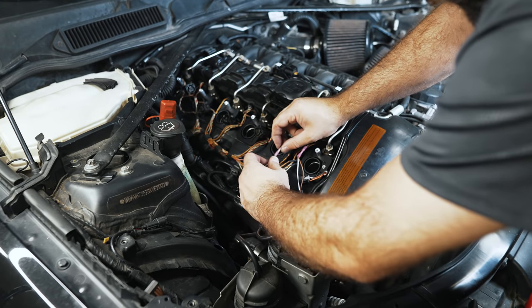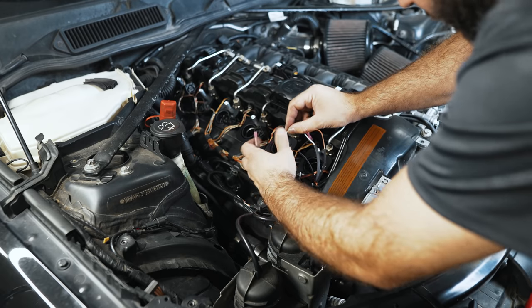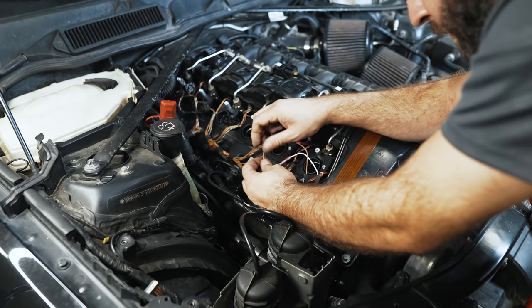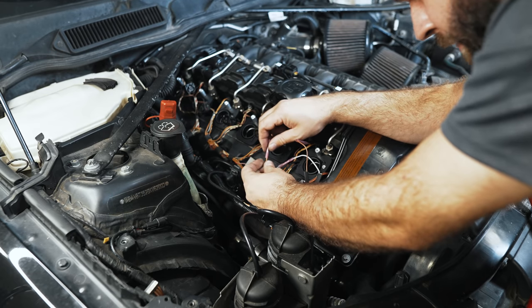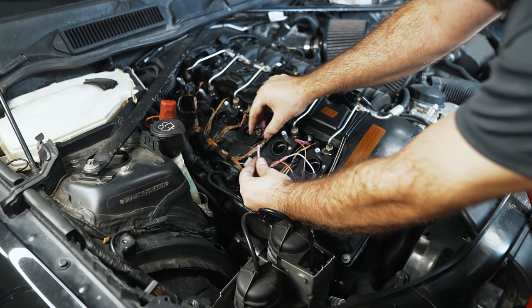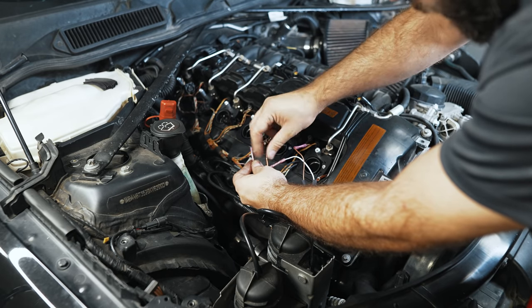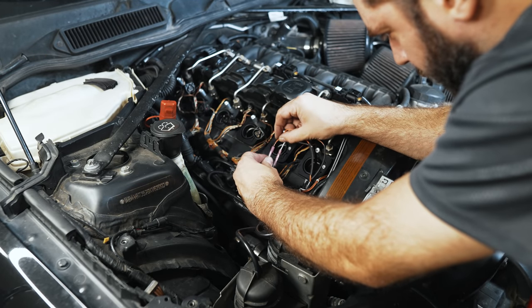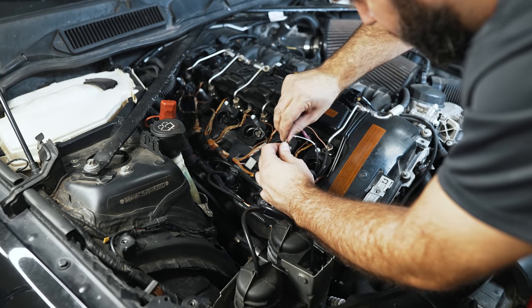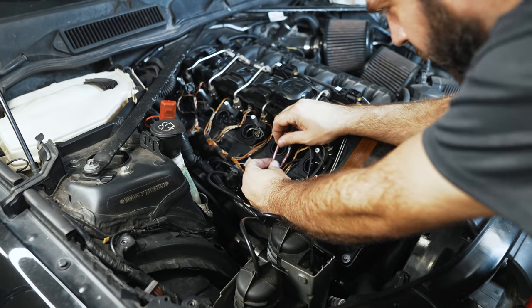If you're wondering about the difference between Audi coils and the coils on BMWs - even modern 2022 models - the ones driven externally with a separate power supply are called smart coils. The standard BMW coils have power, ground, and signal all coming from the ECU or DME, giving maximum control. Because cars are becoming more powerful, manufacturers had to either go to a smart coil or beef up the ECU-driven coils. That's to the benefit of older N54 cars, because they have a three-wire setup and can be retrofitted with B58 coils - you don't have to tell the DME anything different at all. My plan for now until I go single turbo is to run stock dwell - I do have to reflash to remove the Audi coil setting in MHD, but I don't need to run more dwell at my current power levels. Once I go single turbo I'll increase the dwell - that's a simple checkbox when the time comes.